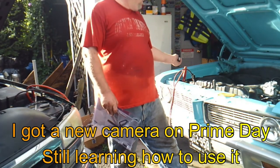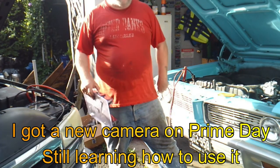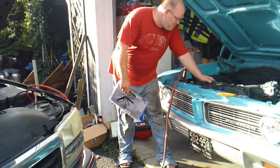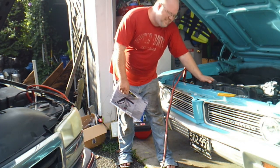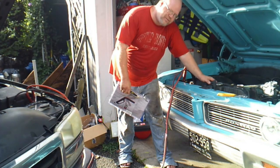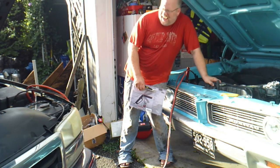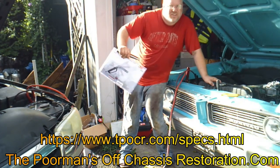So yeah, it's been a minute since the thing's been started. Battery doesn't have quite enough. I'm hoping a little while with jumper cables off the truck will help. While I've been waiting, I've gone ahead and marked the harmonic balancer at the notch where supposedly top dead center is. I made a couple marks on my timing notches — one at zero degrees, one at four degrees, one at six degrees. I looked up online and found a website that has the timing measurements on pretty much any car. I'll put a link up.